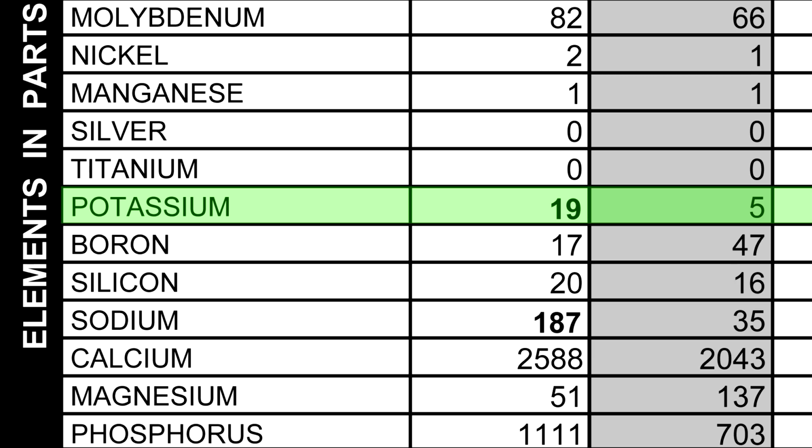And because of the high reading of potassium and the other wear factors, they're attributing this to coolant being present in the oil. So this is because of a head gasket leak. Now, all head gaskets are going to leak after 300,000 miles. That's just how it is. Now, depending on how much it leaks, that's when it's bad. In this case, we're not getting any froth. We're not seeing anything too detrimental, indicating that we have a big head gasket leak, which we don't. We're not losing any noticeable amount of coolant. But because this test is so sensitive, they're able to pick up these little parts per million.